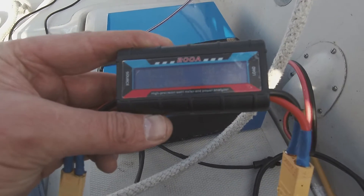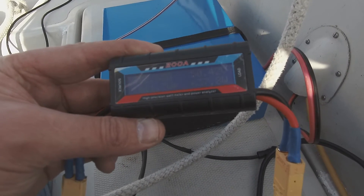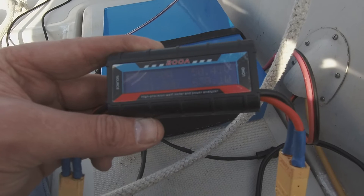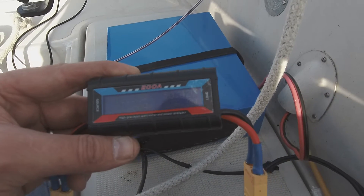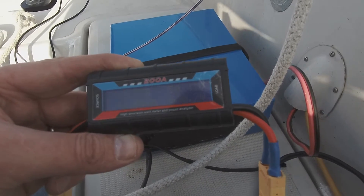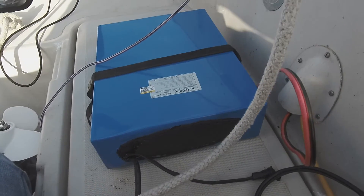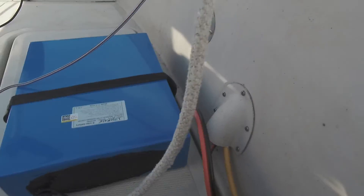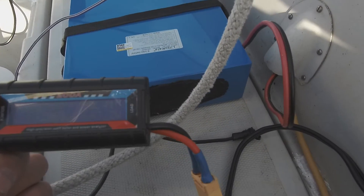Apparently we've used 30 - it's at a 49-volt minimum. One of the things I noticed about this battery from AliExpress is that the cables are very thin. It doesn't seem too warm at 12 amps, but it certainly gets a bit warmer at the higher amperage, and I'm wondering if that's why the other motor didn't work - I think it's maybe not getting enough juice. I'll have to figure that out.